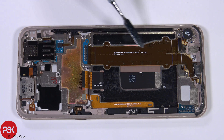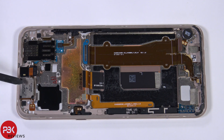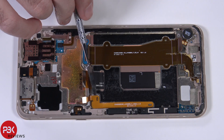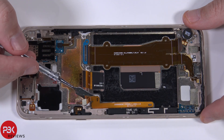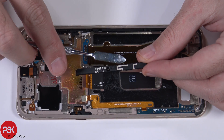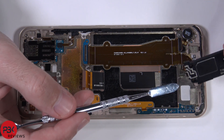Your charger port flex cable comes attached to the board. Underneath it you have your screen cable which runs through your midframe and connects to your main board. You have your vibrator motor down here, your ear speaker on top, and this right here looks to be the 5G antenna — I haven't seen a separate antenna run through a phone like this before. The flex cable connects to your main board, and here is the antenna piece. This plastic cover is important because the lines running through the plastic are part of the antenna, and these contacts make a connection with the lines on the speaker assembly — they run through the other side as well.